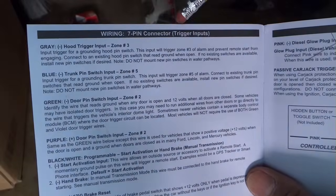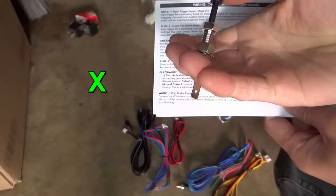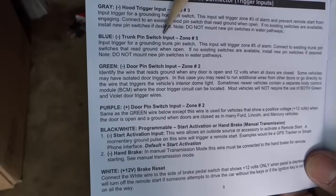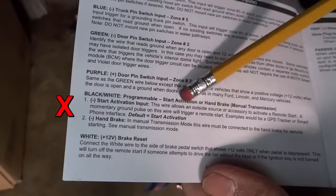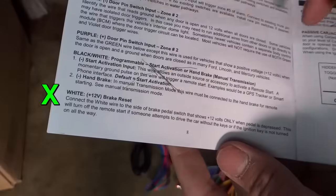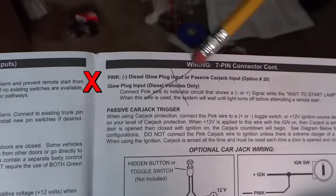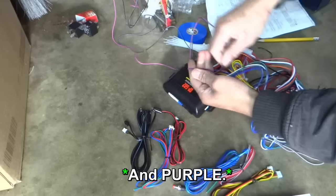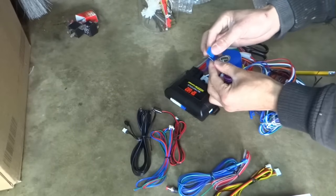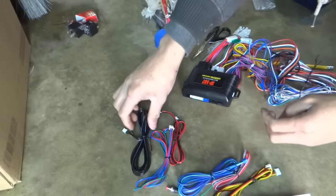At the 7-pin connector, the gray one, the hood trigger right here. Blue one goes to trunk pin switch, green door pin switch, purple black white manual transmission. White, brake reset. Pink, right away, I just cross it off. It is diesel. Black white and pink. Next would be...